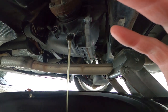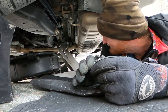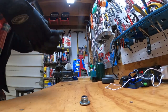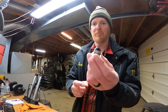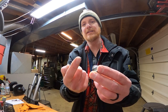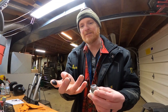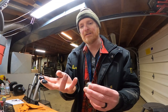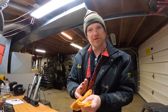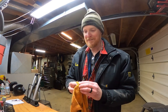Man, it looks gray. It does not look healthy. That looks like quite a bit of sludge already. So this is the bottom plug and it's completely saturated. How is that possible? It's a brand new rear end. I guess that's break-in, right? That's why you replace the lube. I'm glad I'm doing this — obviously, it needs to be done.